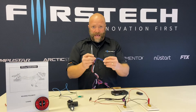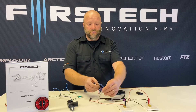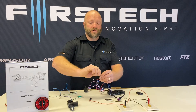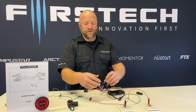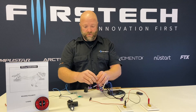The white and white-black wires are pins 87A from our relay pack. Those two wires will get ground for the reverse polarity circuit. We're going to attach ground to those two white wires — the white and the white with the black tracer. Those are pins 87A on the relays inside the relay pack.